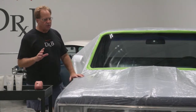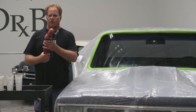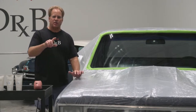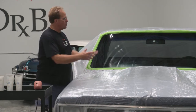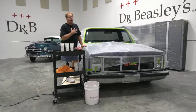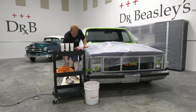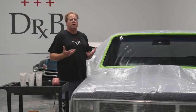And when you're machine polishing glass, while you can do this with about any orbital, the results will come faster if you use a rotary polisher. And the thing about a rotary polisher is because you're spinning that pad in a circle, centrifugal force kicks in and it tends to start throwing splatter everywhere. So that's why for me, and everybody can do this how they want to, but for me, I'd rather tape everything off and save a lot of time at the end of the process, not cleaning things up with a toothbrush like this, and just make the whole process neater, cleaner.